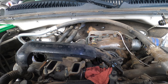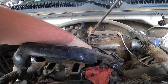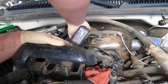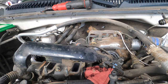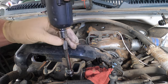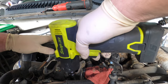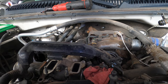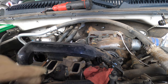Now we're going to pull the hoses off. I've already been draining the coolant for a while now. That's got the wrong hose on it but we'll replace that when we do the heads if we go that direction. We've got those two loose and I'll start getting the dowels loose. There are two 14 millimeter bolts here, both the same. Going to go over here and plug this valve.